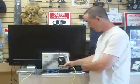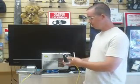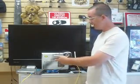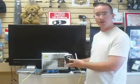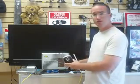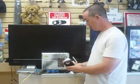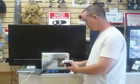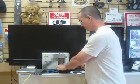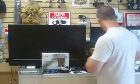It's all in the installation guide. I'm going to log into my IP camera and configure it for wireless access, because right now it's set up to be a hardwired IP camera — which you can use it as — but we want to do wireless. So all we're going to do is configure it for a wireless setting, and once that's done we're going to unplug this from the back of the camera, set our camera back down, and take our plug out the back of our router and set it to the side.